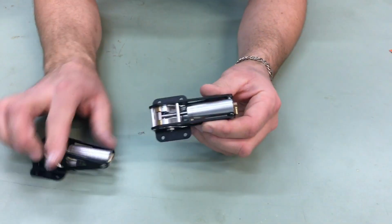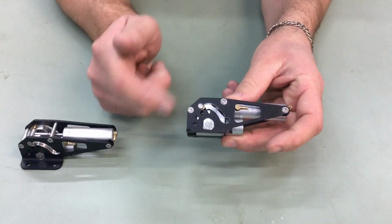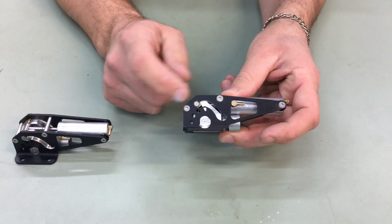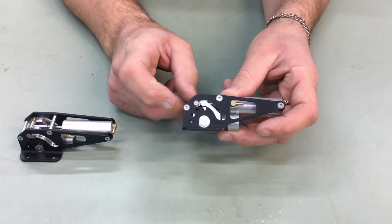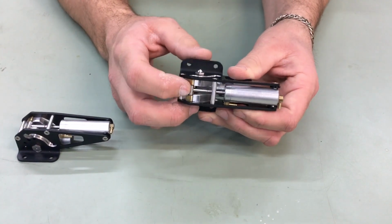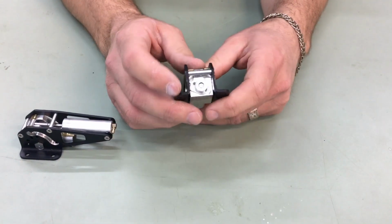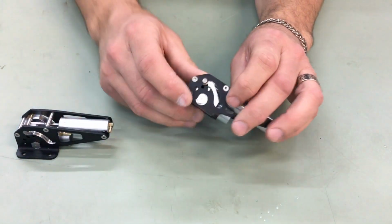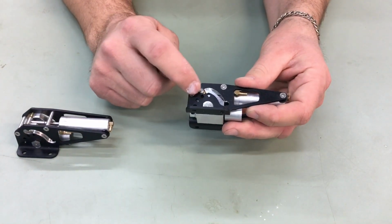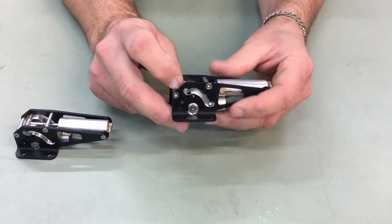Here's our retract unit itself. Again, similar to a lot of the other center loading trunnions or center loading retracts that you would have, you have a positive up and down lock. Okay, you have your cam followers here, the trunnion with the teeth in it. This does rotate via a crow's foot, which will walk through the holes notched in the side of the frame.